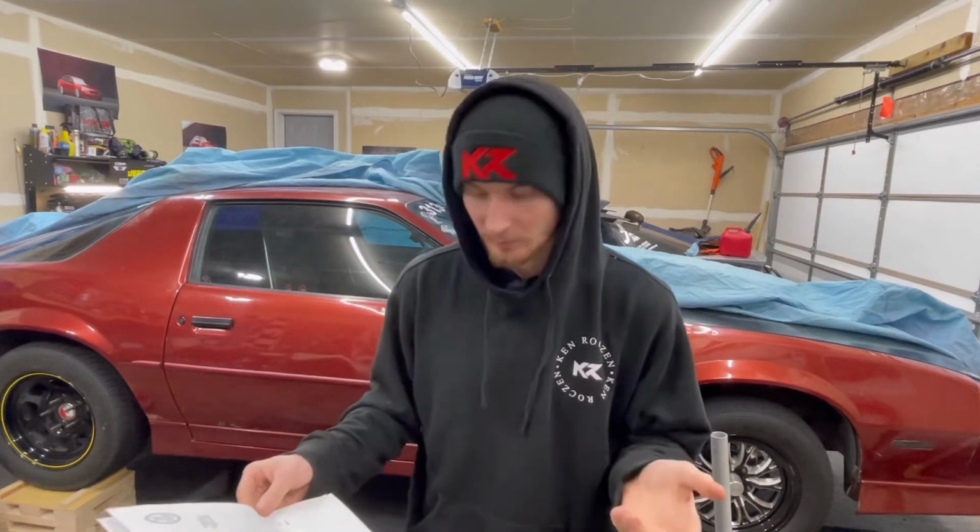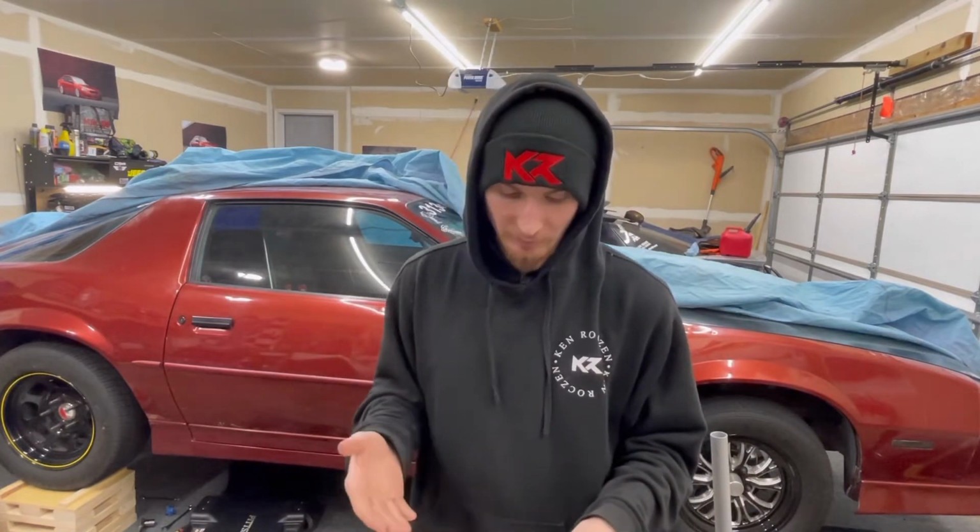We put a new forward rollerized hub in it. It's got a 3440 billet aluminum Pro Mod drum, and it's got a 36 element sprag in it. The reason I went with that is because when I go turbo, I want to have a transmission that can really withstand some power. Plus, this drum and everything should hold up to street driving and higher temperatures in the transmission better, and it's all around just a better part than a 4L80 drum.